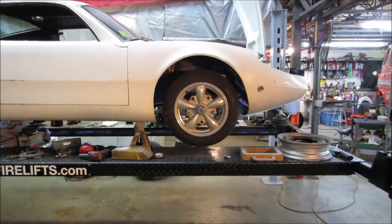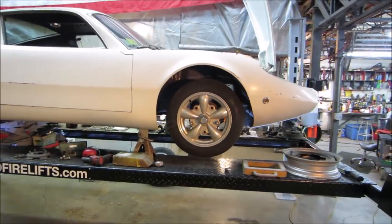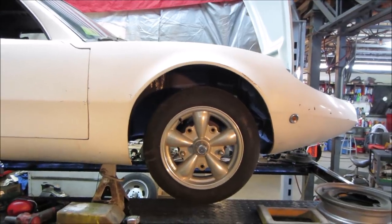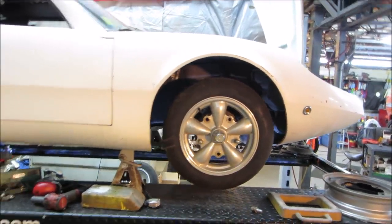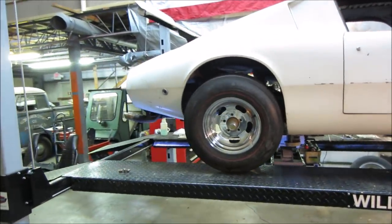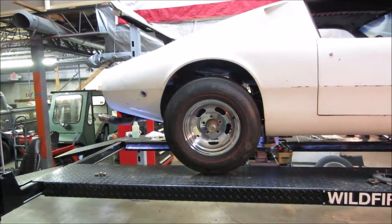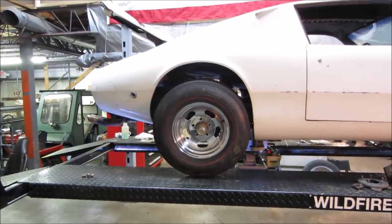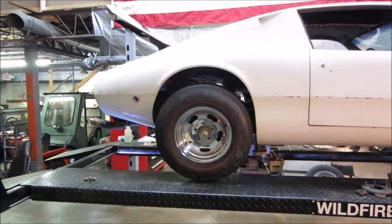Yeah, I got us a little bit better light. Still, I don't know, the rim isn't terrible, but the space around it, I'm just not a big fan of, so I think I have to try to come up with something in between. The back one's not in all the way, but yeah, I guess the idea difference. I would think they probably still sell bias ply tires. Yeah, the other thing is, they ride like crap too. When they're cold, they get a flat spot in them. Shake your teeth for the first 5-10 minutes of riding around.